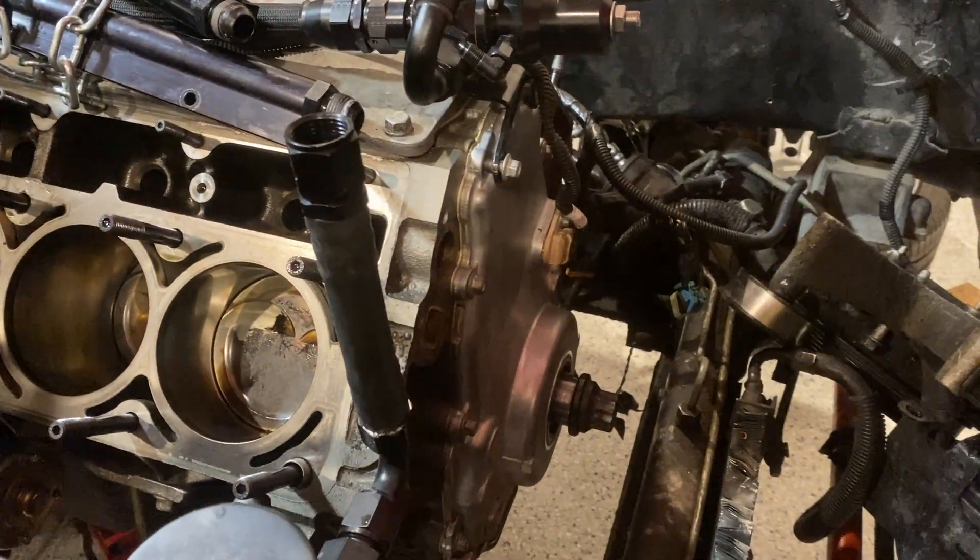The new cam is 250/262 with about 680 valve lift — so out with the old and in with the new. Okay, camshaft is in, timing cover's back on, heads are off and over there. I need to swap the springs on them and then wait for my new lifters to come in so I can recheck piston and valve clearance. I'm going to do something pretty cool with the rocker system that I'll show you all in a separate video — I don't think anyone's done it yet on LS stuff, so I'm pretty excited. Anyway, that's all I've got for this video of the road to 200 miles an hour — I'll see you guys next time.